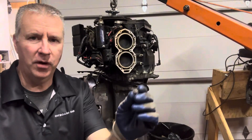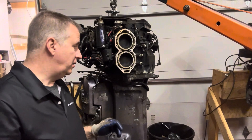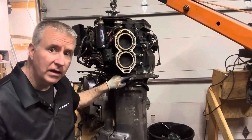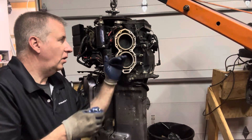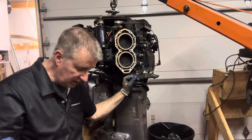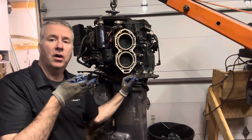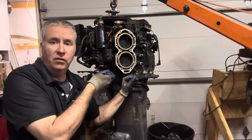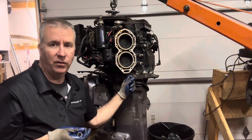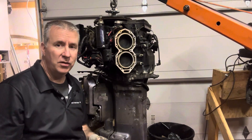Through all the back and forth, we snapped the head of the bolt off — we worked it too hard. Now that bolt is broken inside. So what's the next step? I do have a TIG welder. My plan is to get my cutoff wheel in here in this midsection, slice deep in, and cut that bolt off to get the engine block off, then TIG weld it back up when I'm done. JB weld works really well too. I'll only cut the bolt and try not to cut into the midsection too far. If you think there's a better way to do this, please comment and let me know.